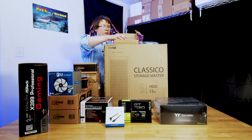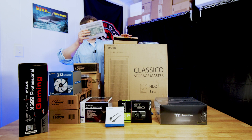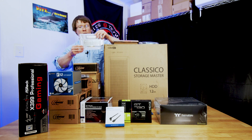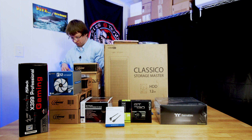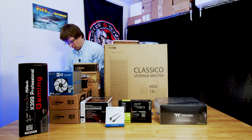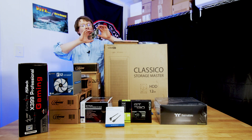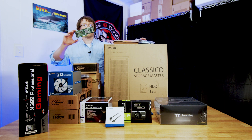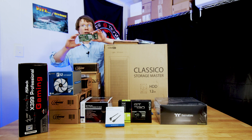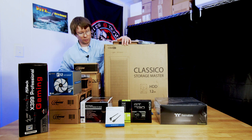This is our HBA, picked it up on eBay. I'll put a link to it — none of the stuff is sponsored, I don't have any affiliate links, I buy all this stuff myself, so if I put it in the comments it's simply for your reference. It has both a half height and a full height bracket. We'll be putting the full height bracket on it. It has two SAS connectors on the back, and those are 1-to-4. So we'll have eight of our hard drives coming off of this, and we're going to hook one more in with a SATA cable directly to the motherboard. So that's about it for parts — let's get all this junk off the table and start building.